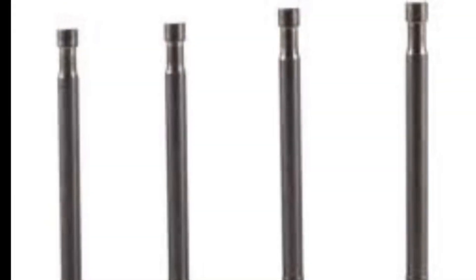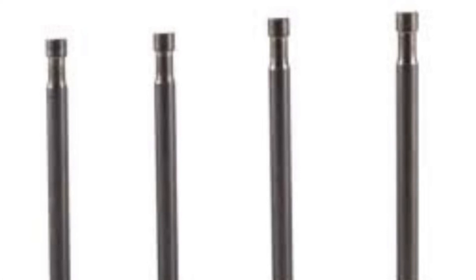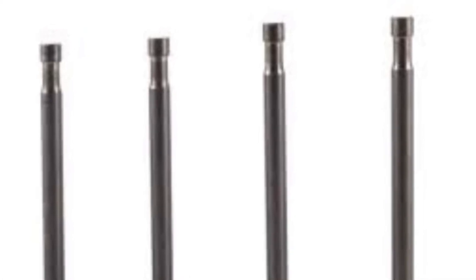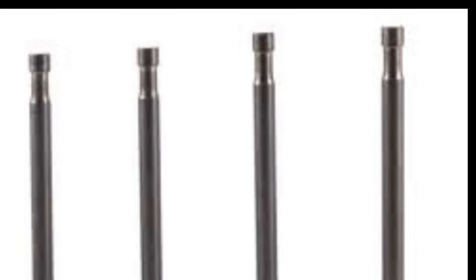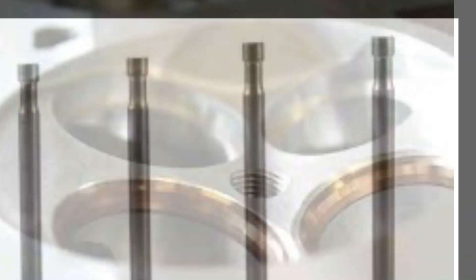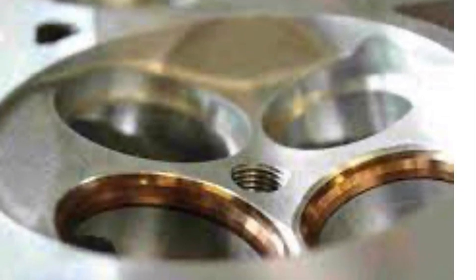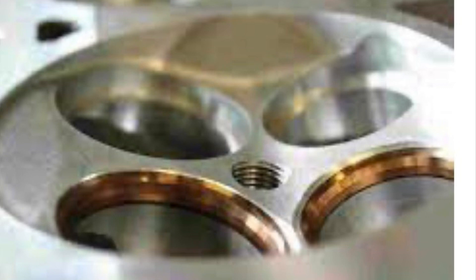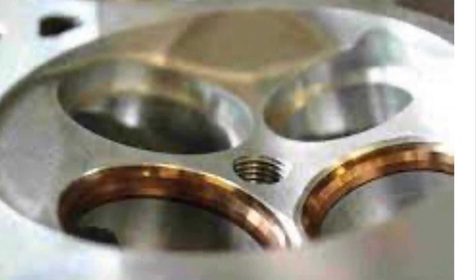This picture shows what valves look like: you've got the long stems and then at the bottom it almost looks like a mushroom head, and that's the part that has to seal up against the valve seat. As long as the valves are sealing against the valve seat well, we generally don't run into problems. Here you can see some valve seats — where it's shiny and kind of gold — that's where the valve sits against the seat and seals. Problems happen when the valve isn't seating properly.